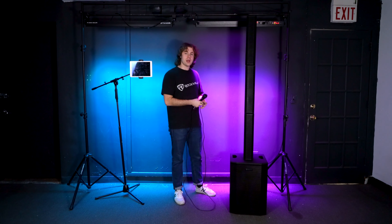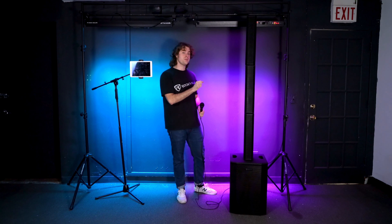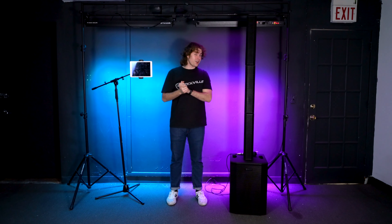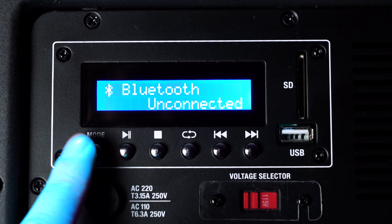Because we can connect a microphone and a Bluetooth device to the Titan Array system, it makes for a great karaoke setup. To set up my microphone, I'll take the female end of my XLR cable, plug it into my mic, then take the other end and plug it into the mic input on the back of the sub. Remember to press the button next to the input to set it to microphone mode. Then raise the mic volume knob — check one two — you'll hear my voice coming out of the system. Now we'll connect a smartphone or tablet to play music and read lyrics on screen.